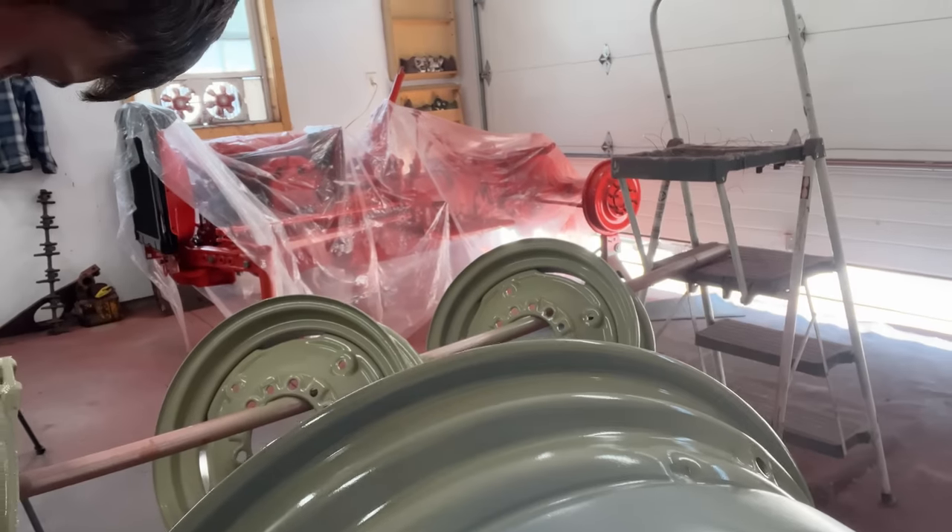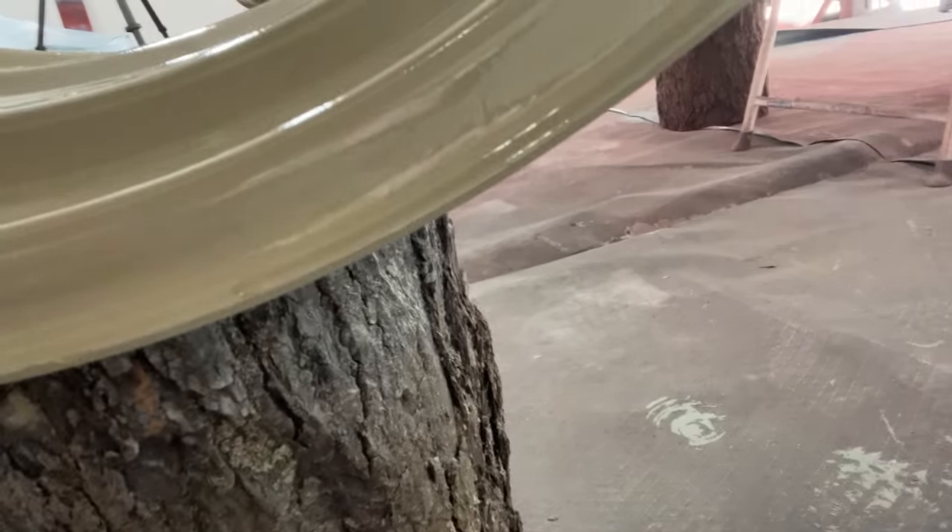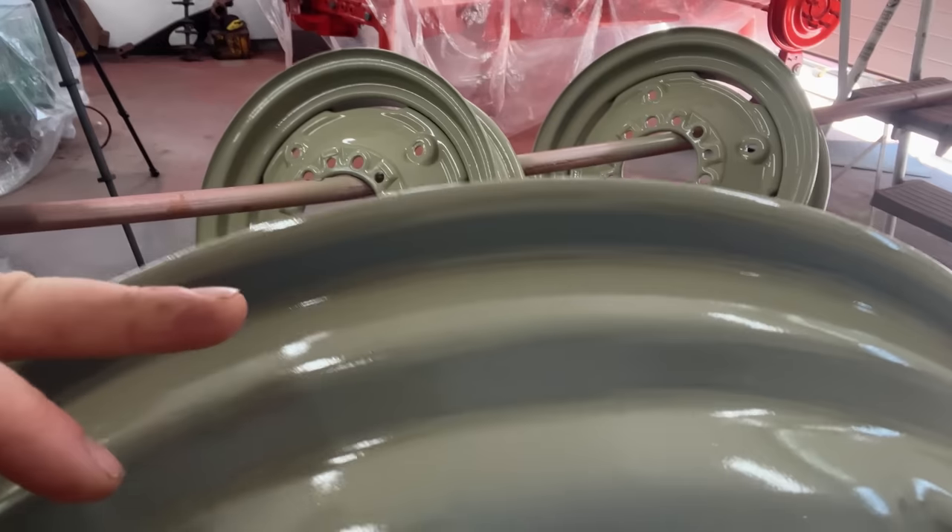I just learned something today. Remember when I didn't know what they mean by recoat time - they say like 8 to 12 hours? There are two options. One - what we always did with automotive when painting primer, base coat, or clear coat - is as soon as it tacks up and you know it's not going to run again, you can hit it and build that up as thick as you want, as much as you want, you just cannot let it run. Or, once you pass that window of recoat time, you got to let it dry completely and then sometimes you got to scuff it. We're going to let it rip - I'm going to put my second coat on right now. The more you know.